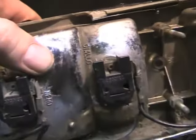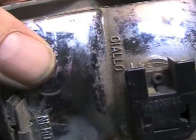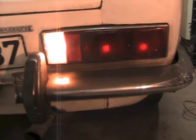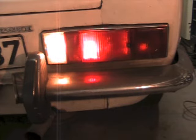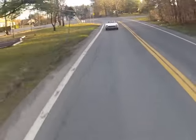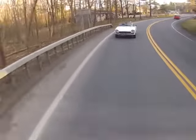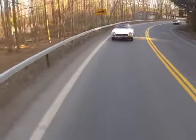Sometimes they'll even stamp the wire color in the back of the component — this is at the tail lights, and there's a yellow wire hookup there. The key point is that your Fiat wiring is an electrical system complete with numbered circuits and electrical components tied together with different colored wiring sets. So take good care of your Fiat 124 Spyder — they're a lot of fun and they're way better than walking.